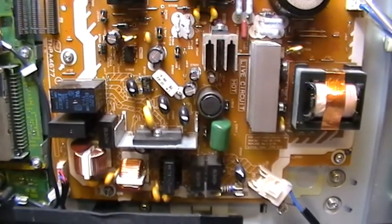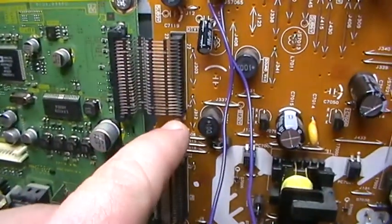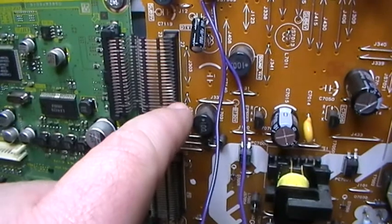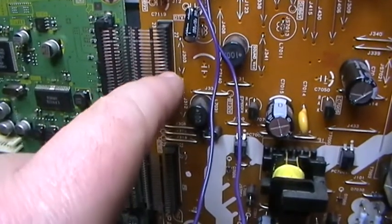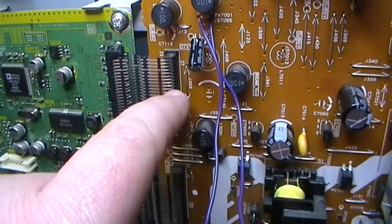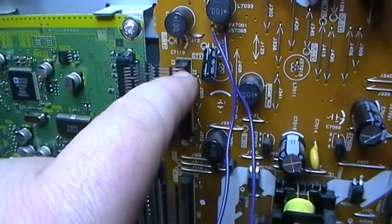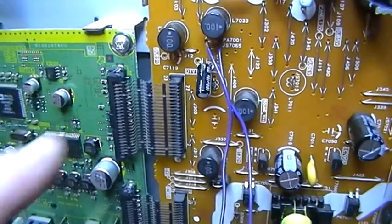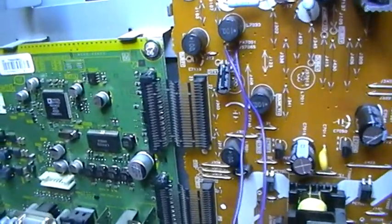I checked it around and made sure my voltages are there. Pin 2 is 30 volts, pin 4 is your 5 volt rail, and then pins 12, 13, and 14 are 8 volts. The last pin is 20 — the last 4 pins are 12 volts. Two are for your panel and two for the DTS, digital TV side.